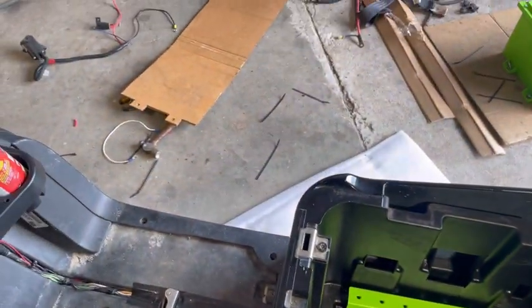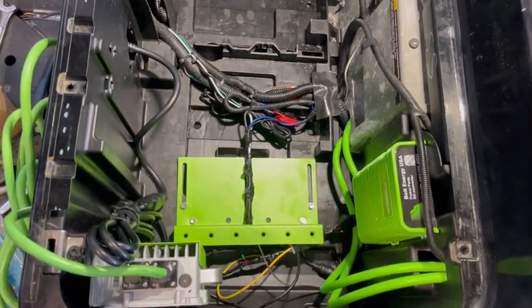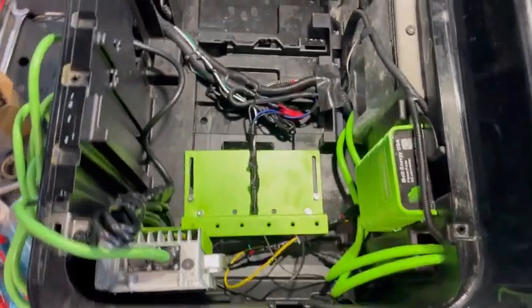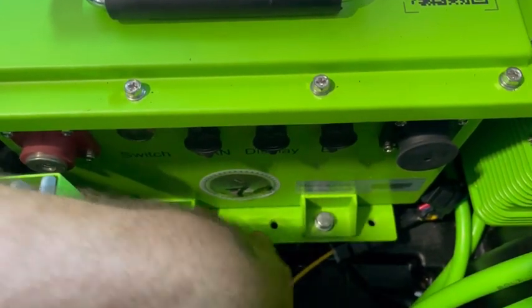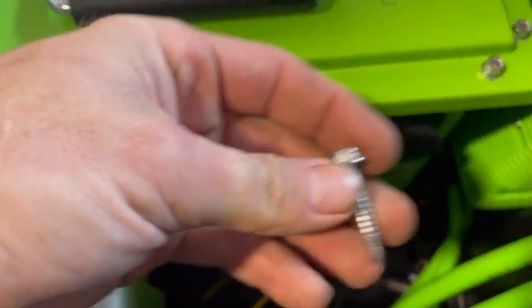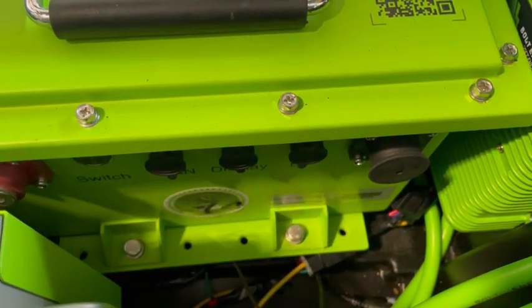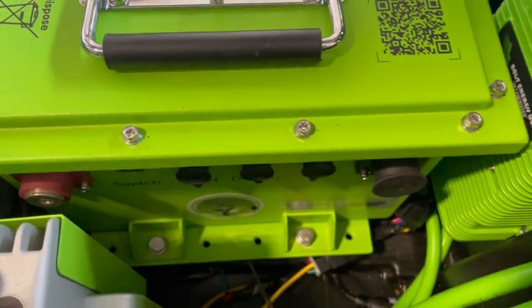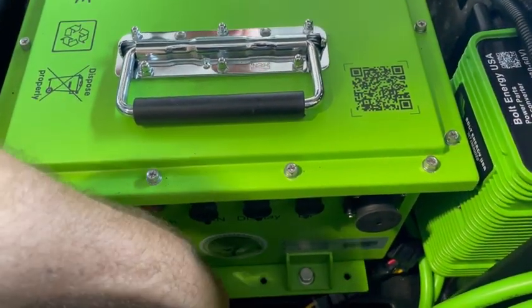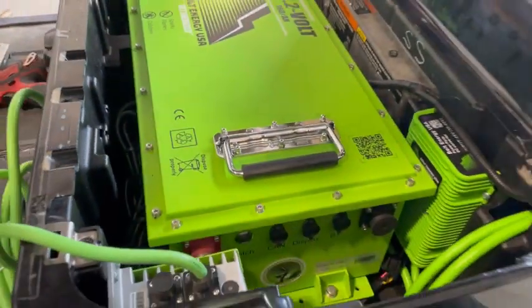Mounting brackets are added using the cardboard template. Everything's out of the way and we're ready to drop in the big boy. For the main mounting brackets, secure them with a thick self-drilling screw and make sure you're making contact with the main aluminum chassis and going through it — that way the bracket will be most secure. After that, we mounted our bolts for the battery to the bracket, and John is very carefully working on the last two in that tight corner.